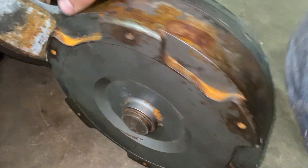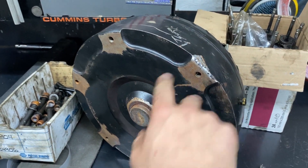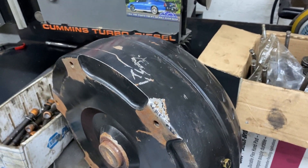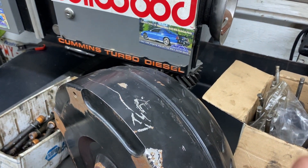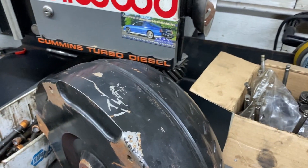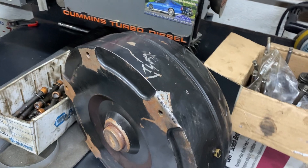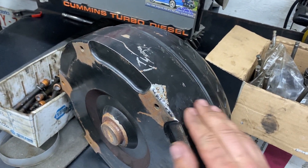Here's another converter - just a little smaller pockets on it, but generally a nice thick big machined surface for the triple disc holding portion. You can sometimes see drain plugs. Another thing is color: the stock converter will be bare metal in most cases, maybe a light gray or black, but aftermarket ones will sometimes be blue, or black, or purple, or gray. Just take note of color and thickness.